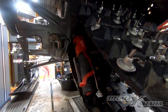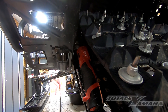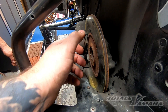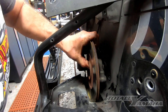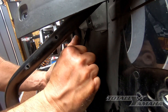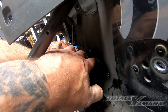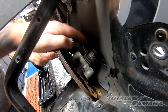We're going to pull out the three 10 millimeters on the brake caliper side — you have to go through the tunnel just about by the drivers. Once the bolts are out and the C-clip is off on this side and the brake pads are out, if you start to rock it back and forth, you can basically pull it right off. You can see down in there that the bearing was spun just a little tiny bit. I'd say it's about 15 thousandths off of that shaft, but we'll double check once we pull it off.